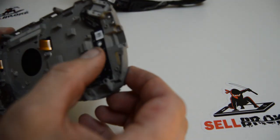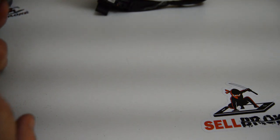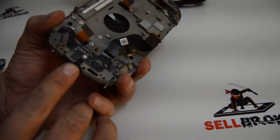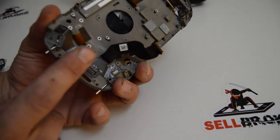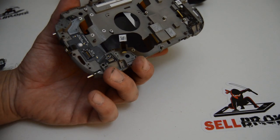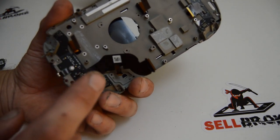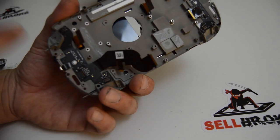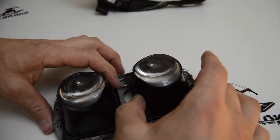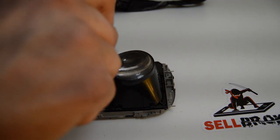We'll be leaving the little ribbon in place. It looks like the power button is integral to the ribbon, so unfortunately if you have a power button issue you're going to have to use a heat gun or something to really soften the adhesive to be able to pull it up. They also have liquid damage indicators - kind of the same as a Mac.